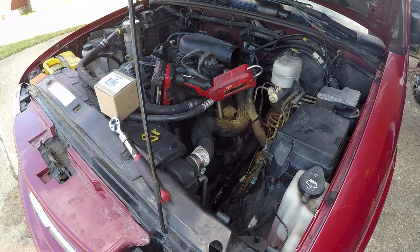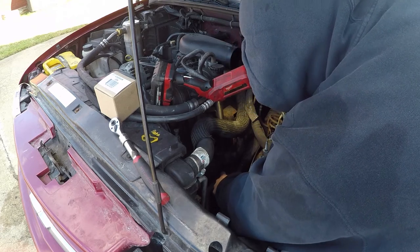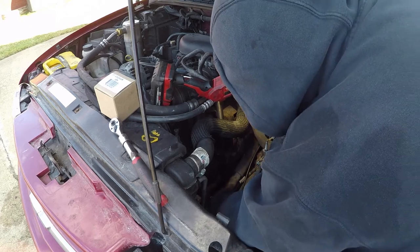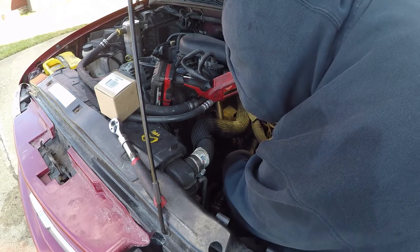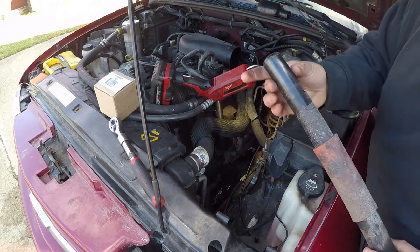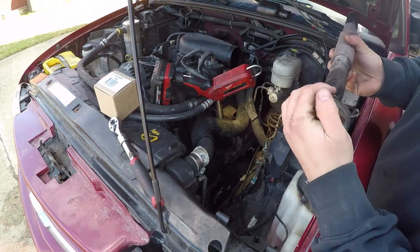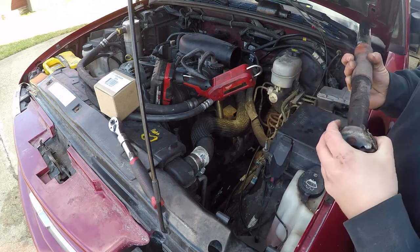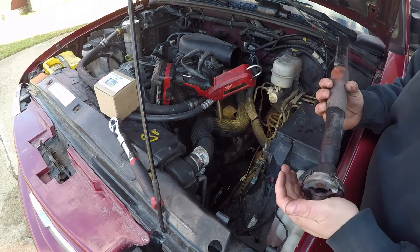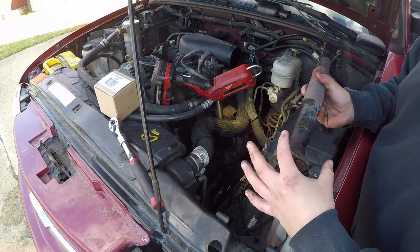So now pick up on the shaft and give her a tug, and there we go. There's one steering shaft — there's a boot up there that comes over this. But as you can see, there's a good bit of flex in that old coupler. So we'll cut these two rivets and punch those rivets through, and then we'll bolt the new one on.